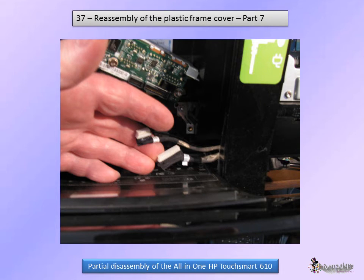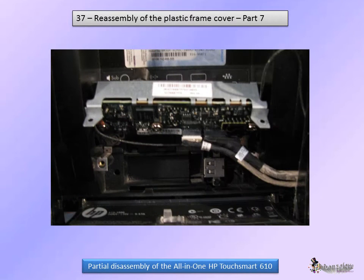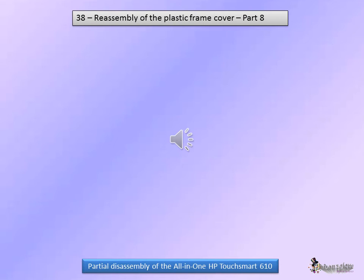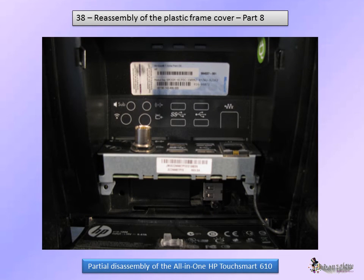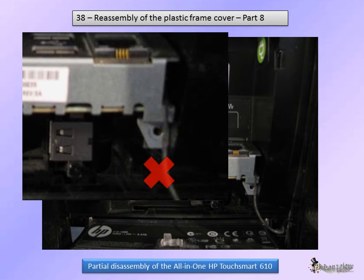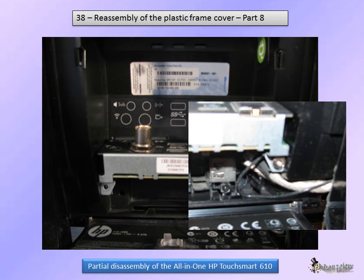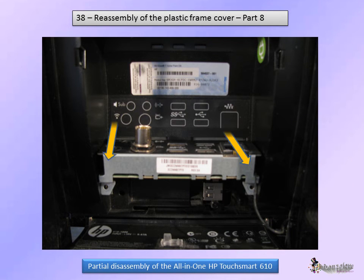Open the cover again. You need now to insert the black wire in the passage from the right, as well as the two connector cables. Wind the black wire back as it was before the disassembly, then plug the two connectors back. Here you need to look through the whole sequence beforehand. You're going to insert the two tabs of the block in the holes and then put it back into position. Watch out — the black wire must not be led over the right tab of the block. You need to lead it under this tab, otherwise you will not be able to put the plastic protection back into place. When this is done, you may tighten these two screws and then close the cover.